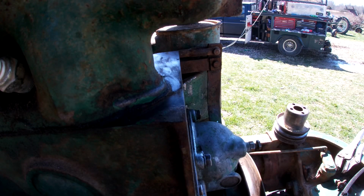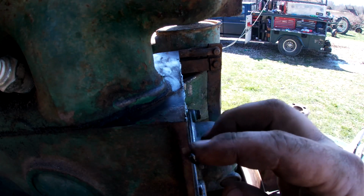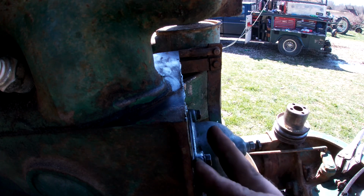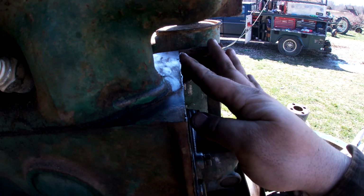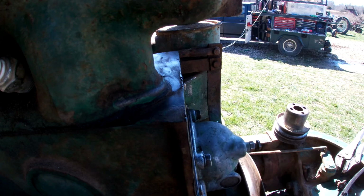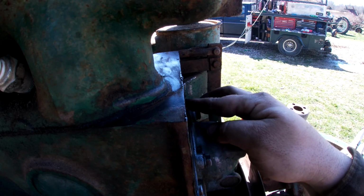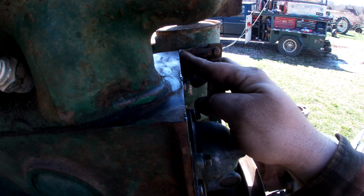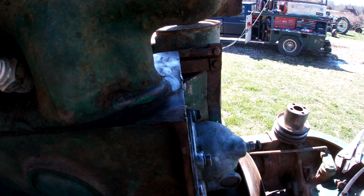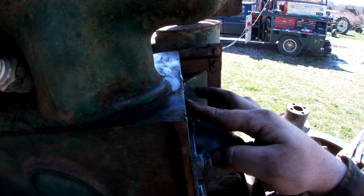And on a water pump, I'm gonna use just a little film of my favorite number 2 Permatex. It just helps, it seems like, seal up the leaks if there's an imperfection in your metal. But you can overdo it, so just the lightest little film. That'll also help hold your gasket in place. So, added bonus.